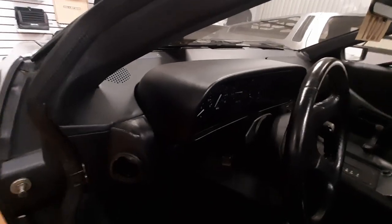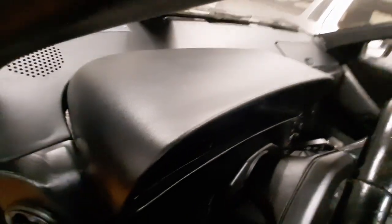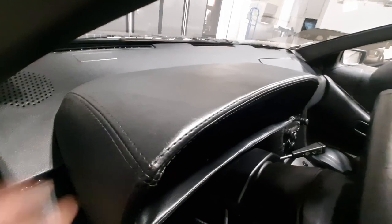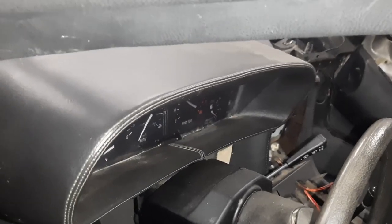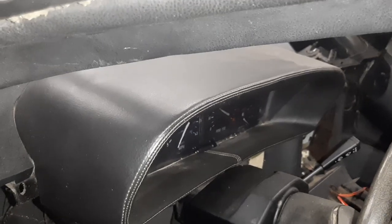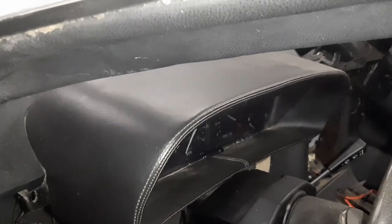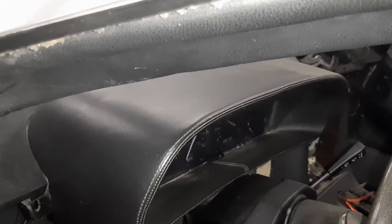I'm going to show you three different types of binnacles. This is a vacuum-formed binnacle that you're going to see on most cars — they split kind of right down here. This one's in nice shape, hasn't seen much UV and has not split. Here's a recovered binnacle — you can tell it's been recovered by the baseball stitching down the sides. This one had a crack down the center and it got recovered to cover that up and refresh the interior. Here we have a factory leather wrap binnacle with a seam down here — that's the way the factory did it. I like recovering split binnacles because the factory did make a small number of cars with leather wrap binnacles. That vacuum-formed binnacle has not been available for many years, so there is no replacement — the repair is a recover.